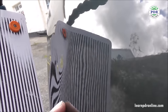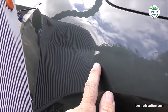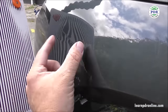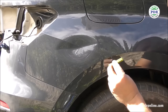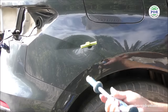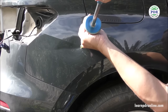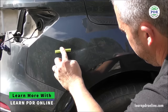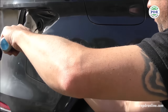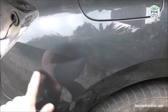This time I won't be really tapping that crown - I'm going to continue my pull along this crease line. Same again, one that side, one this side, bring it in towards the crease. Setting up once again for the next stage of glue pulling - it's a similar process. I'm aligning these tabs and once again watch the direction of my slide hammer. Gradually bringing it round to the right, and that is encouraging the left hand side of that tab to lift towards the centre of the dent, then repeating on the left hand side. Let's have a quick assessment of the panel - you can see I've massively reduced the overall size of the damage, reducing the crease from the left and right hand side, bringing it all in towards that centre point across the body line.